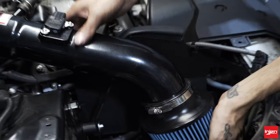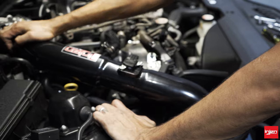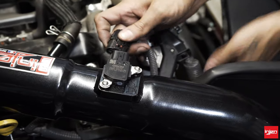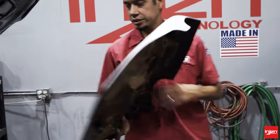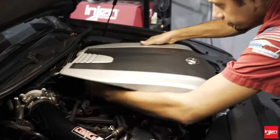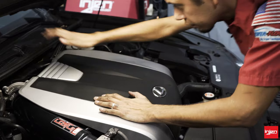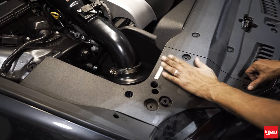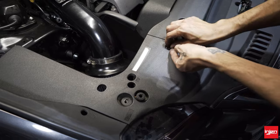Tighten the M6 nut on the vibramount — nice and tight. Verify again — always good to make sure nothing touches. There are trim seals for a nice seal on the back end. Everything looks good. Depending on how you want to route your harness line, you can hide it or leave it exposed — click that back in. If you disconnected your battery, go ahead and put that back together. Reinstall the engine cover — there are three little grommets that help locate it. Reinstall the plastic cover; remember when you push the clips down they pop all the way back up, and that's how you reinstall them.